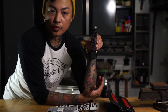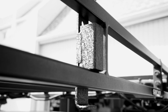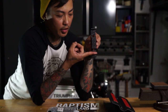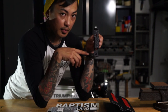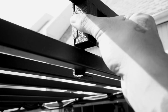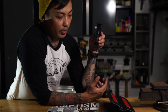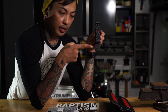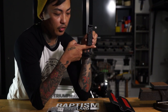The Garvin Expedition roof rack works a little bit differently. This is actually a little too tall for the roof rack sides that I have, because one bar is right here, the other bar is right there. So the width of this doesn't match up. On top of that, the space between my two rails, there's too much play on here. But it's a really, really easy fix. What I ended up doing was just drilling an extra hole. So imagine that this is the bottom rail of my roof rack. I'm just going to let this sit on the bottom rail so that there's some support there.